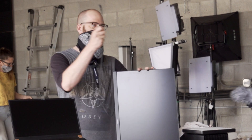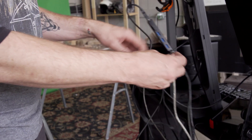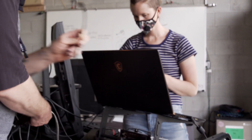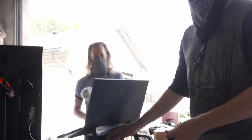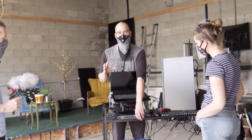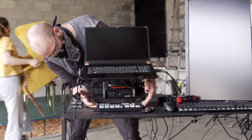The monitor is connected via USB-C cable, plugged right in. There's also a USB 3.0 breakout that most things are plugged into. The keyboard and an Ableton launchpad are connected — we use the launchpad for triggering sound effects and laugh tracks, because it's good to feel good about your funny jokes. The other USB is going into the Zoom F4. We run all the audio through a single audio interface because if you put everything through the same device it'll all be on the same latency — if you use multiple devices you're going to start running into echo issues.